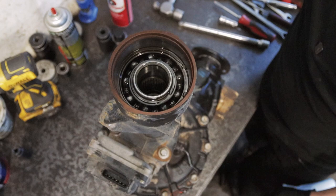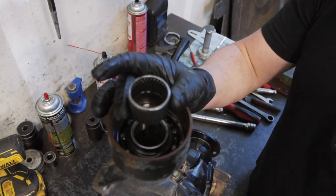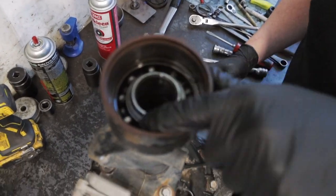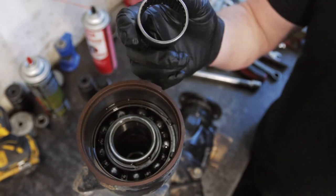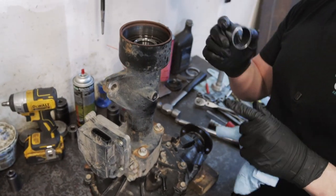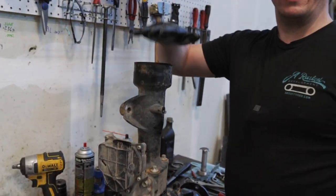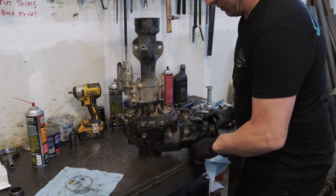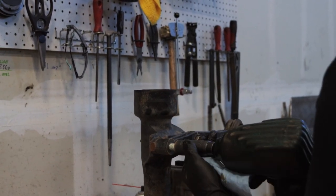This is the radial ball bearing that holds the driver-side CV axle in place — and this is the bearing that holds the passenger-side CV axle in place. There's a significant size difference there. People wonder why the clamshell bushing is such a necessity and why it's only applicable to one side — it's because there's nothing wrong with the driver-side bearing. Now we've got to put on the dust covers.